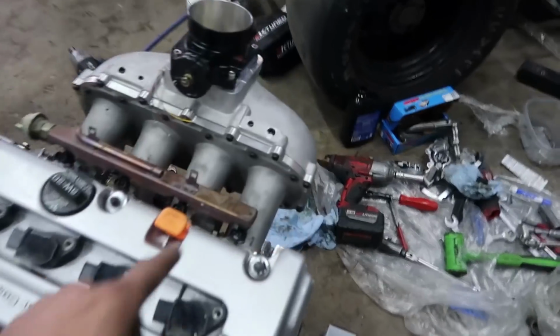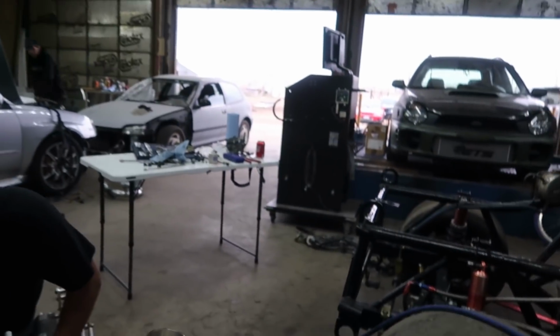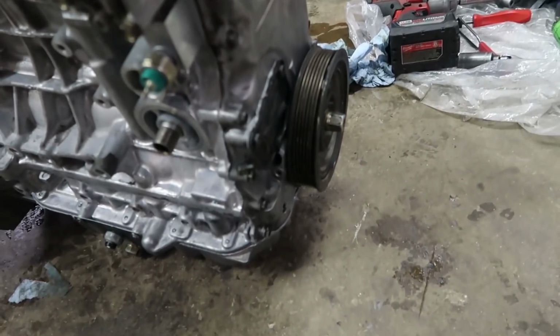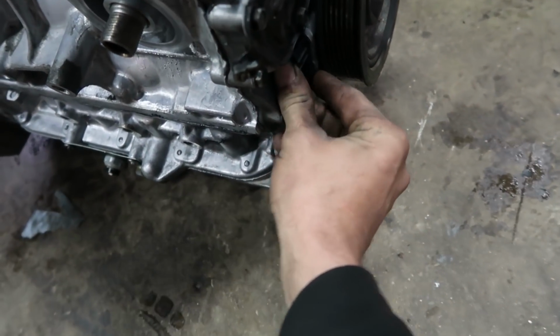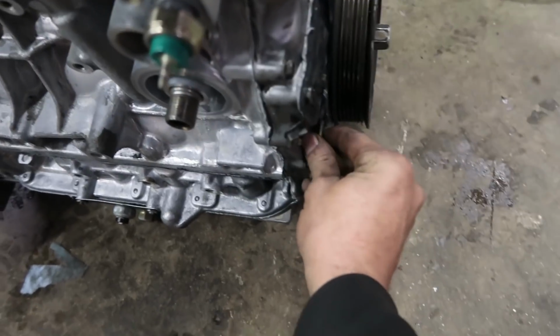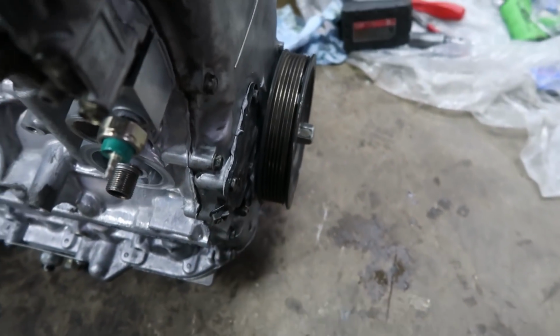Looks like while I was gone, they got the plugs all put in. And there's a port on the bottom for your rear. So I just need to put the new crank sensor on. K-Series have two different style crank sensors. There's a 02 to 04 style and then 05 up style. And this one here takes the 02 to 04. So I ran to my storage unit, picked that up. And now my harness will plug right in without having to change plugs or run around.